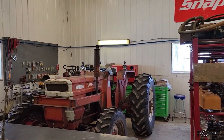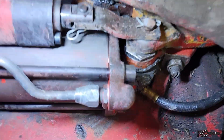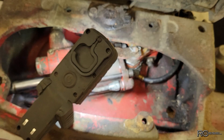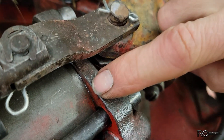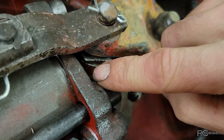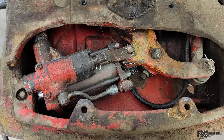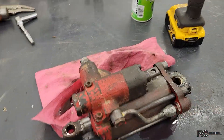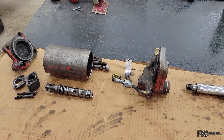Whoa, what is this — look at all these wires in here. I found the power steering leak — it's leaking right at the split there. This head fits inside the barrel and there's an O-ring in there, and I guess that O-ring must be leaking. It is not that fun to get that cylinder out of there. Well, we got that silly thing out, so now I can take this all apart, get some seals for it, clean it up, put it back together. But it does not look like a seal kit is available for this cylinder.